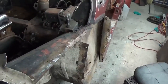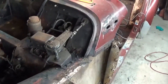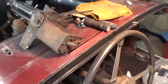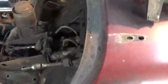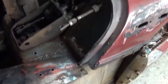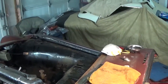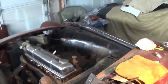We'll try to get that windshield wiper motor off and then probably call it a day, unless we get some more energy and come back out tonight. We got the wiper motor off — didn't come off with too much issue. Once we had the fender off, we were able to access those two cage nuts underneath. The metal is pretty good under there, so I'm happy about that. The metal on the fender looks pretty good too, so I don't really have too many concerns. Tomorrow we'll probably get out here and take out the wiper rack mechanism, then start working on removing the passenger side front fender — we'll make a full day of that. Thanks very much.